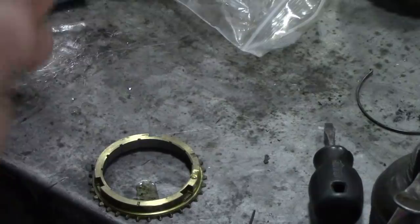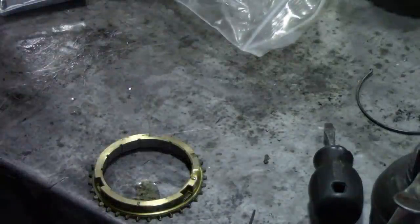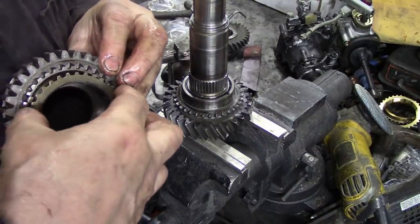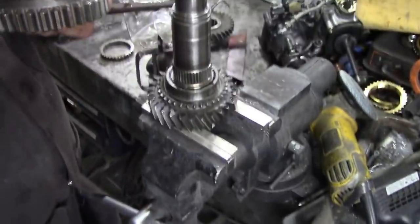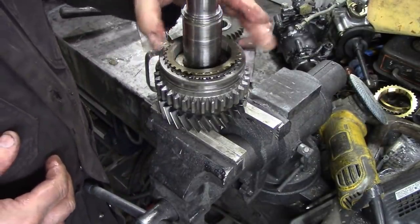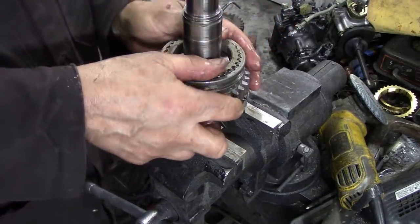The next thing we're going to do is fit this on. And this bit fits — which I always get this wrong — it goes towards the outside. So let's move the camera again. Now we've got all this lubed up. We're going to pull that ring off temporarily and fit it inside, to locate so our little bits and pieces don't jump out. We're going to fit this — this is the selector ring — and this goes to the back of the outer side of the shaft, the transfer case side. Put that on and drop it down. Selector ring, synchro ring, turn it till it lines up. Locate those notches and put that down there.